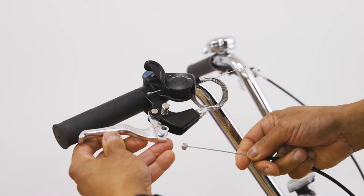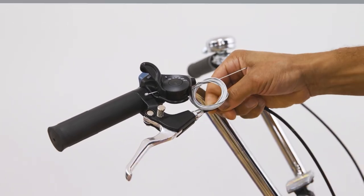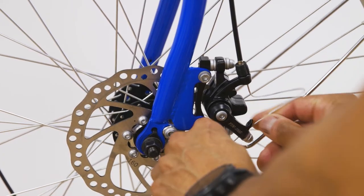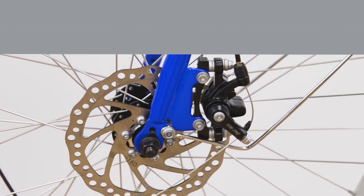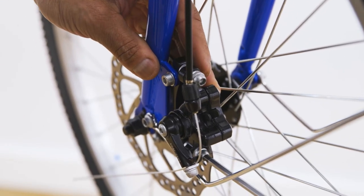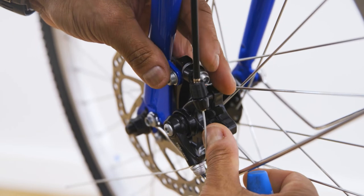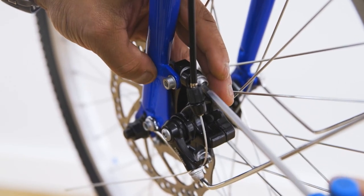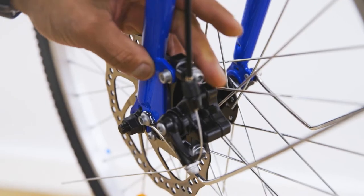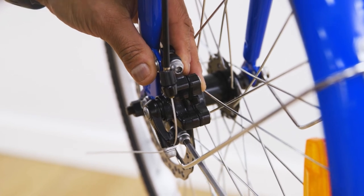The first step when setting up our brakes is to connect the brake cable to the lever. To adjust our brakes, we will start by loosening the two bolts holding the front brake caliper to the fork while squeezing the front brake lever, and then re-tightening the two bolts. This should center your caliper over the disc. Any small minor adjustments can be made by gently loosening the bolts and moving the caliper by hand into position. You can look down the disc to see where your caliper may be grazing the disc and adjust. Once tightened, the lever will feel firm after 4-5mm of travel. We can then repeat these steps for the rear brake.